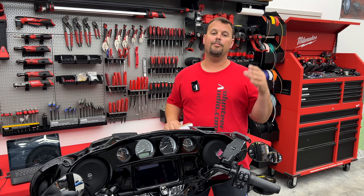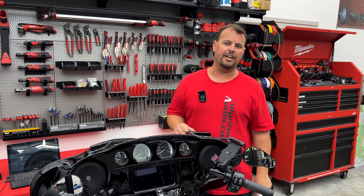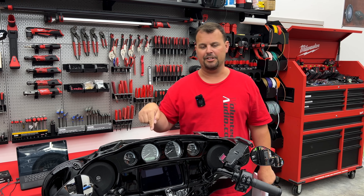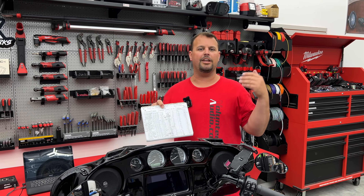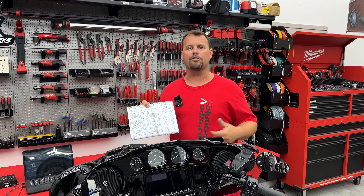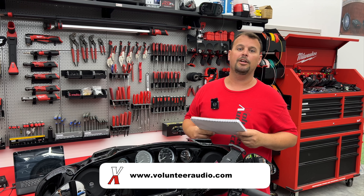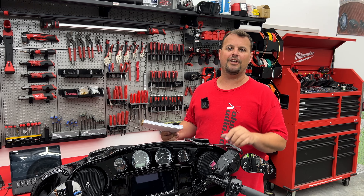I've spent many, many hours testing Harley radios, doing all the techno research flashes, and I've put together a database of all the EQ.BIN files in the factory radio. I've made sure that I know the voltage that comes out of the radio, what happens to the bass boost, if the rear speakers work — all the things we need to know to confirm if the flash we're using is the right flash for our audio upgrade. These are going to be available in a much easier to read format at volunteeraudio.com, and I'm going to show you how to pull that number out of your radio so you can go there and find out which flash you currently have.